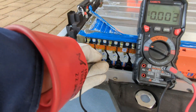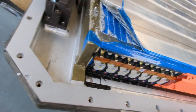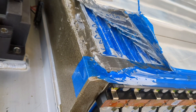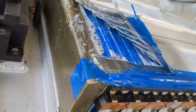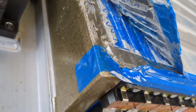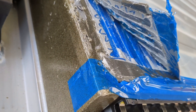Now the next thing I was going to talk about while we're out here is these little cooling plates. A couple of people have asked me about the cooling cells — the cooling plates across the top of the battery. I'll see if I can get you in nice and close here. So this is where I've pried it up a little bit. If you have a look, these blue bits here are like a plastic wrap on the actual cells themselves. The cooling plate sits on top — it's just aluminium channels. Each line goes along here and then back again, rinse and repeat across the whole top of the battery pack. This blue here is the actual cells themselves wrapped in a blue cellophane plasticky stuff.